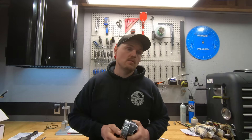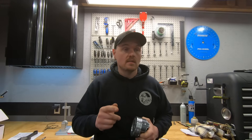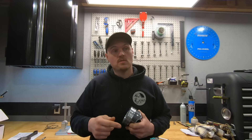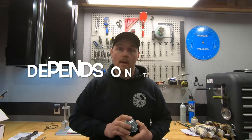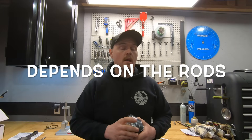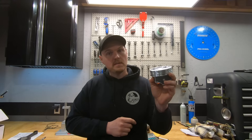So in that case, it was good that I checked. If you're doing an aftermarket crankshaft that hasn't ever been balanced and you don't know anything about it — it's brand new — you definitely want to get that balanced. Second thing is rods. We have rotating mass, which is your crankshaft and your big rod ends and bearings. If you're changing rods, oftentimes you want to get a balance too — not always. But in this video we're going to be talking pistons. Some people will say if you're changing just pistons you don't have to balance, but that's not always the case.